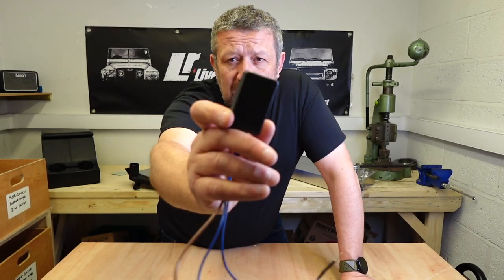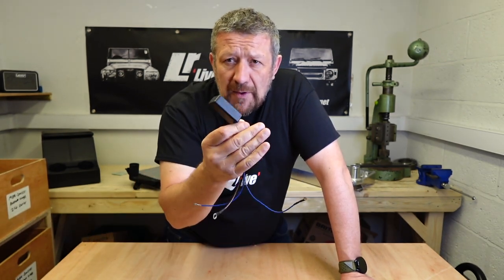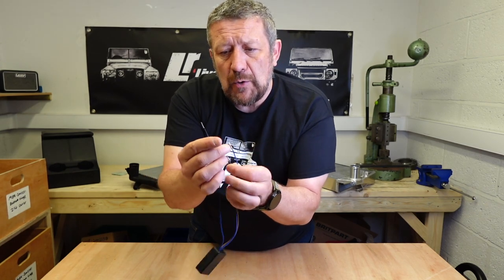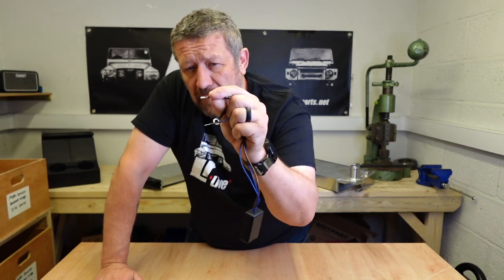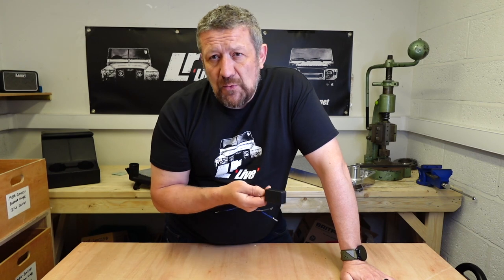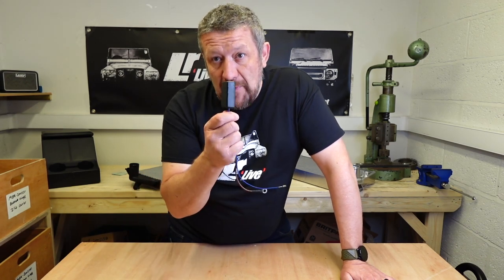You do have to fit the turbo boost box, and all this does is stop the vehicle going into limp mode or throwing up engine warning lights. This one from Britpart is £100 and it connects directly into the existing loom and fixings on the vehicle, so you don't need to buy any additional fixings. It's all perfectly suited to slot in — plug and play — but it's essential because you don't want the vehicle thinking it's over-boosting and shutting down.